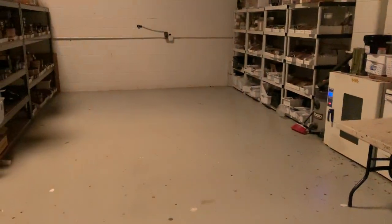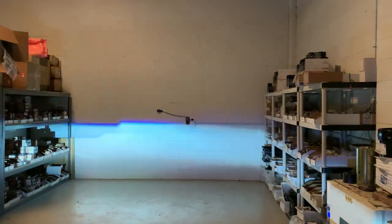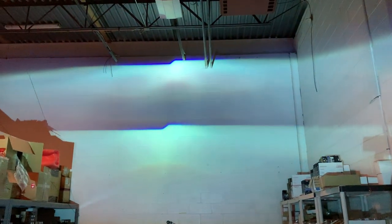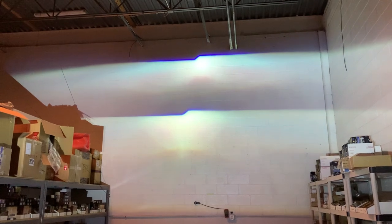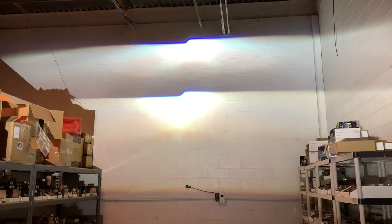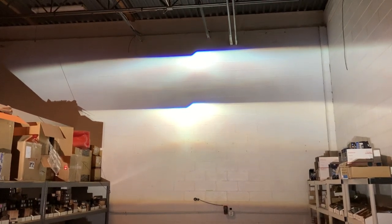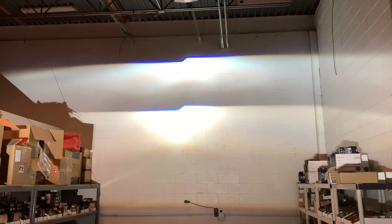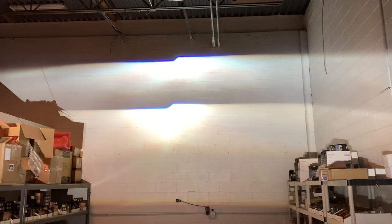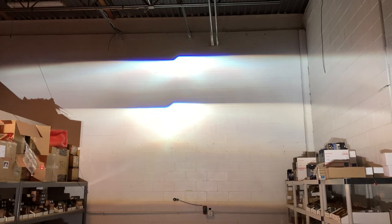One thing to note about the G5R: it's got a very, very good intensity, but a lot of customers state there is a bow in the beam pattern, and that's all due to the optical design of the whole setup. The G5R gets its intensity because the hotspot — the shield placement in relation to the bulb — is a little bit different, and therefore you get that bow. Other projectors on the market might not have the intensity, but they're a little bit straighter to the side. The lower projector — that's the D2S Micro — has more of like a V hotspot, and the G5R is a little bit tighter, more of like a band toward the cutoff line.